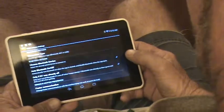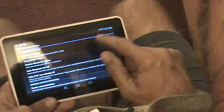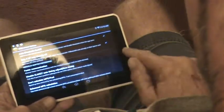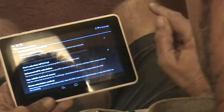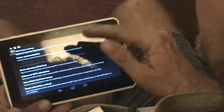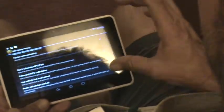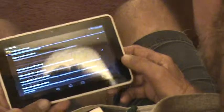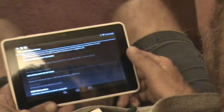Under OBD2 adapter settings: if you want your adapter to come on automatically when you open Torque Pro, keep that checked. Enable faster communication - yes. For 'Don't calculate miles per gallon in fuel' - if you tick that, even though you may not be calculating fuel mileage on screen, it'll be doing it in the background. So rather than spending time and energy on that, just check it, and it will be quicker on your other sensors.